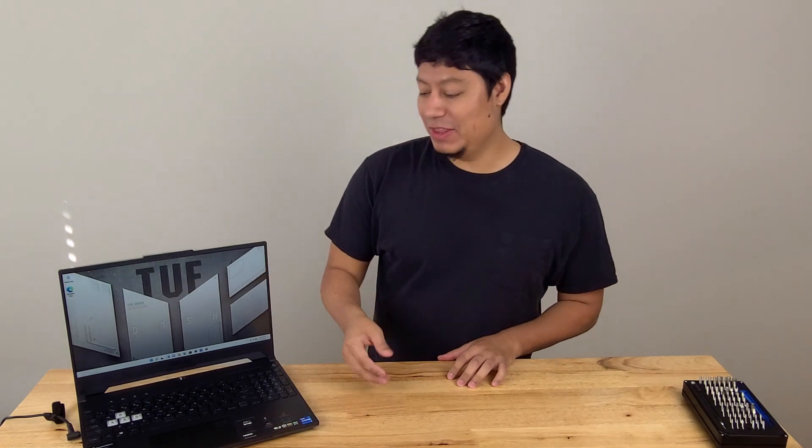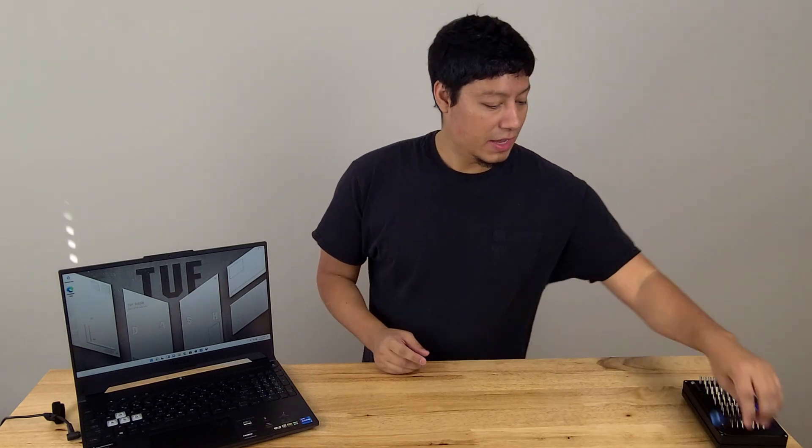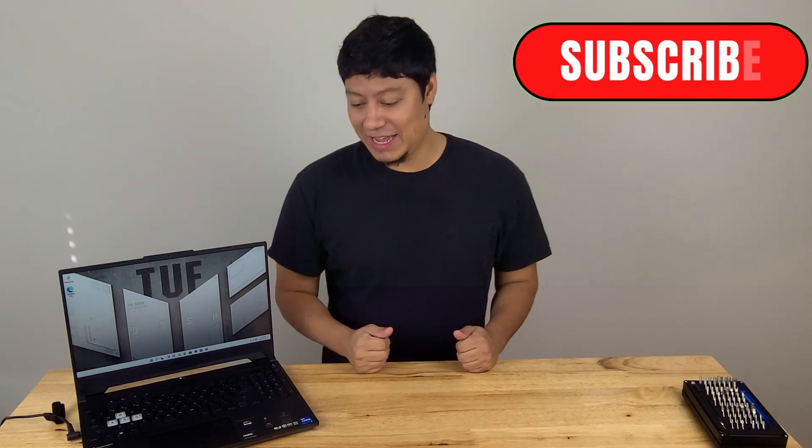A little bit of advice: when you change the RAM on the computer, it will take some time for it to boot on some systems. You might be stuck on a black screen waiting for a minute or two. Definitely if you're going from 8GB up to 32 or 64GB, it does take a little bit longer. Also keep in mind: use PH1 screwdriver so you don't strip any screws, and only use a plastic pick — never use metal because you can scratch the system. If this video was helpful, make sure you share and subscribe. Thanks again to Computer Upgrade King for lending this system out, and I'll see you on the next video.